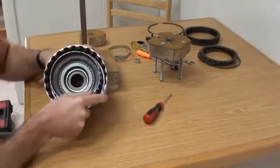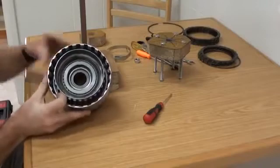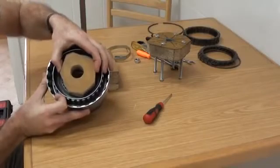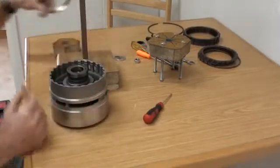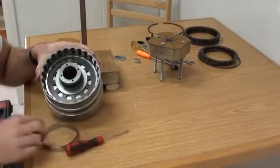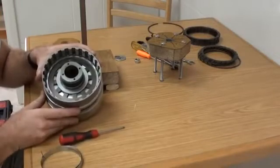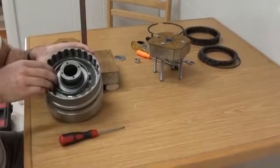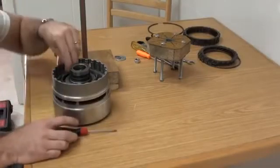Also unlike the other bits, the thing you're actually going to press against on the other side is this piece here, which is the freewheel. To do that, all I've done is cut out a pretty rough old piece of timber that's going to sit in there as we turn this thing upside down to compress it from the other side. The ring I've made to compress this — on the other clutches you'd have it out towards the edge of the cutouts, but on this one I actually want to have it a lot closer, because I'm going to use a lot more compressive force to close those springs down, and I don't need that room inside to remove a stop ring.